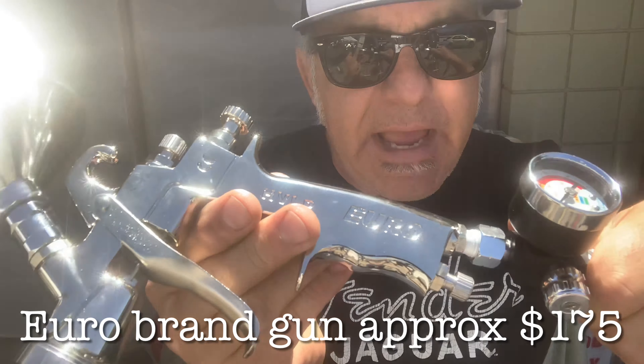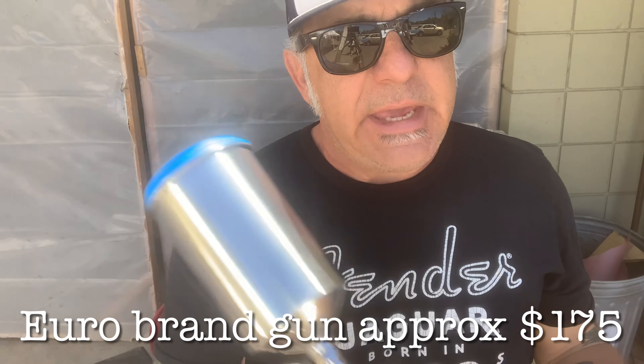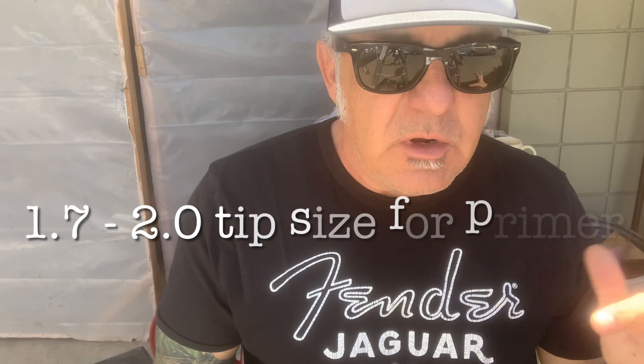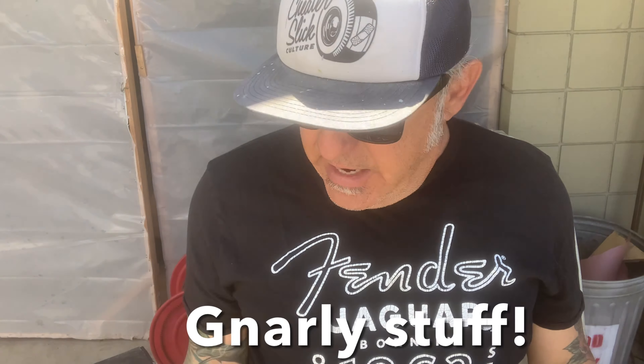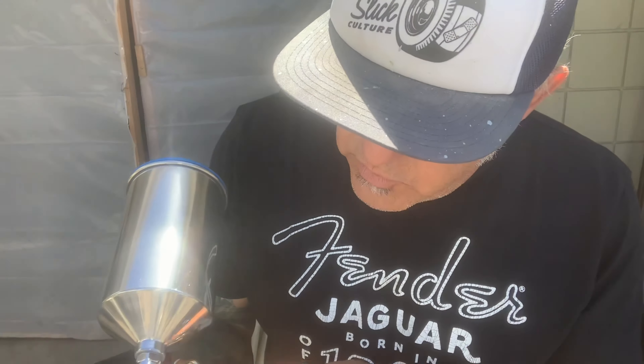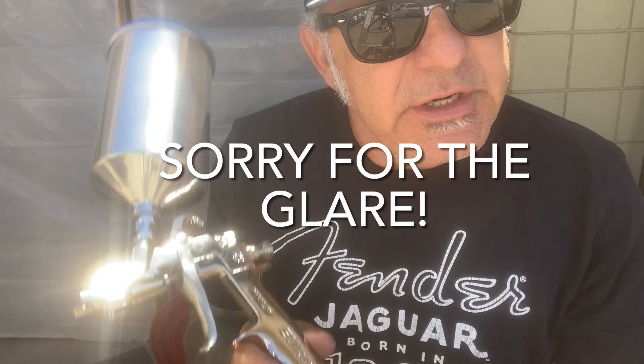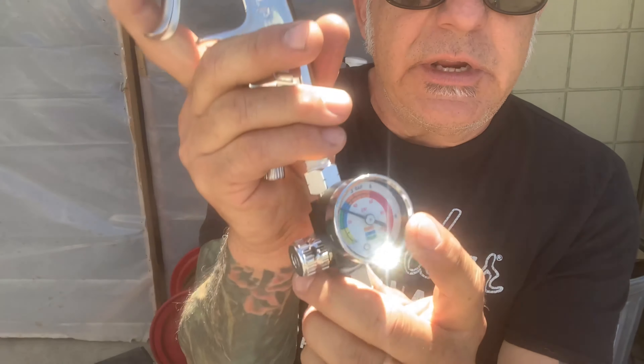We're going to go ahead — I'm going to mix up about three or four ounces of this, I'm going to shoot the rims, give it about three coats. I'll do the flash coat first, let that set up, do another coat, sand, then do the final coat. I'm using my Euro gun — I got this at Polo's Auto Body. You can't shoot more than 20 PSI out of this gun; it only has a 1.3 millimeter tip, so it's only for paint and clear coat. If you want to shoot primer, you'll want something with a tip of 1.7 to 2.0, and you also want a gun specifically for primer.